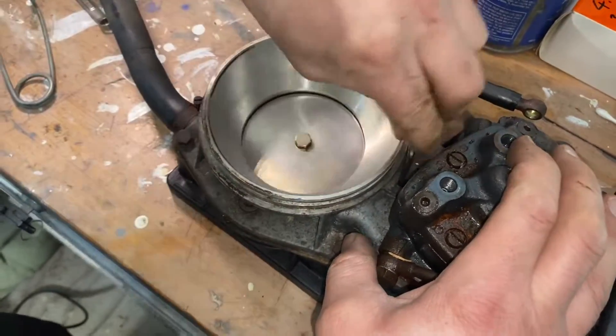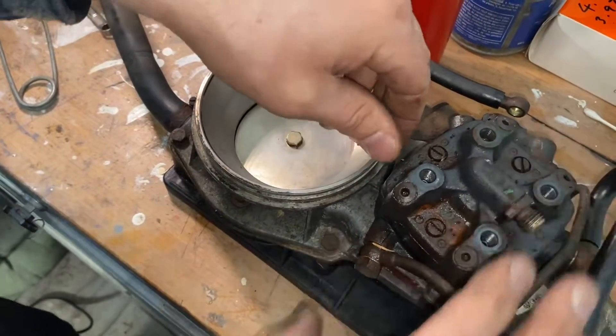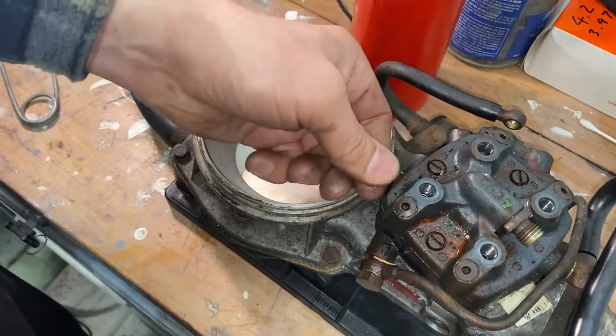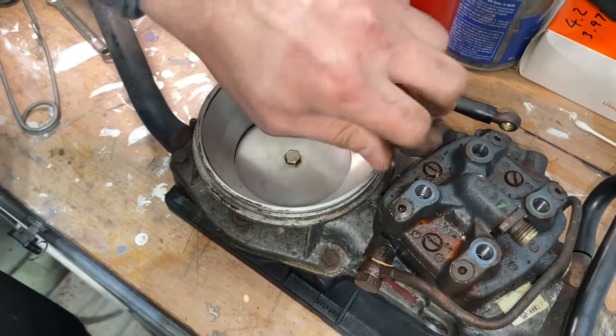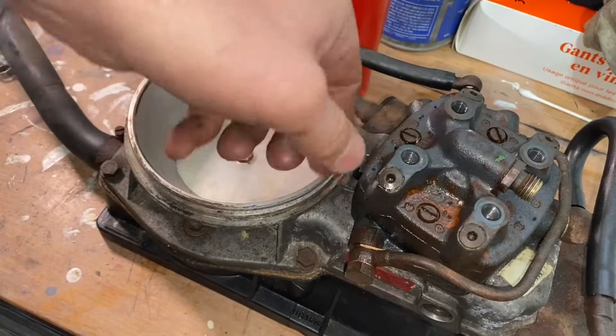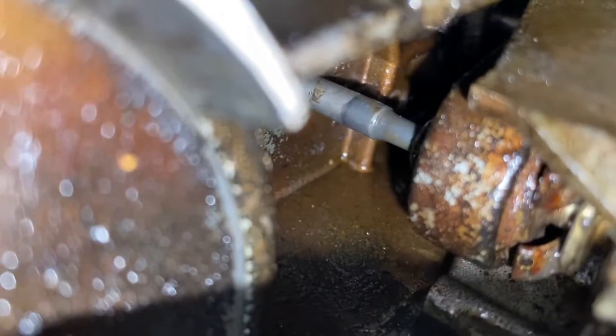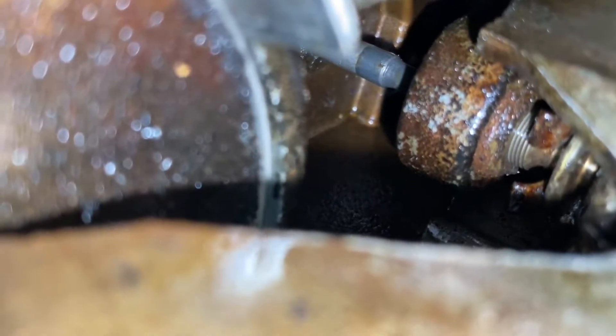Now I'm going to move it back and forth and grease this thing up. You want to go back and forth, each time going a little bit further — screw it all the way in, all the way out, put WD-40 on it. Counterclockwise gives less fuel, clockwise gives more fuel, and it'll be fractions of turns to increase it. I'm going to put anti-seize on the threads, screw it in and out a few times so it never seizes up again.